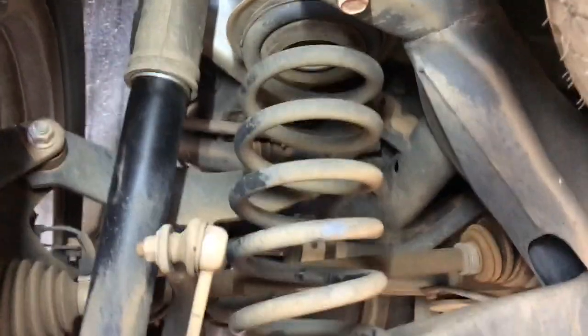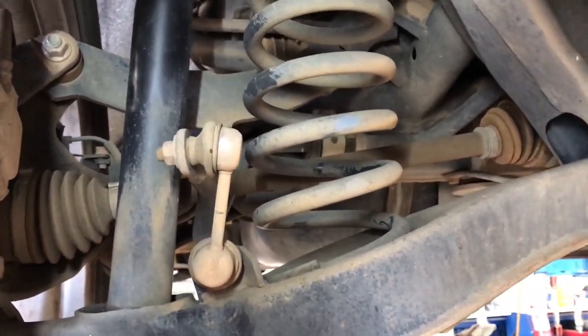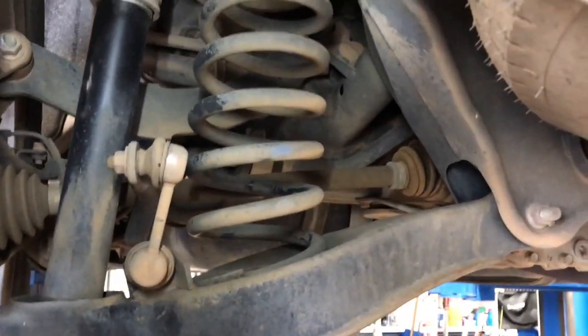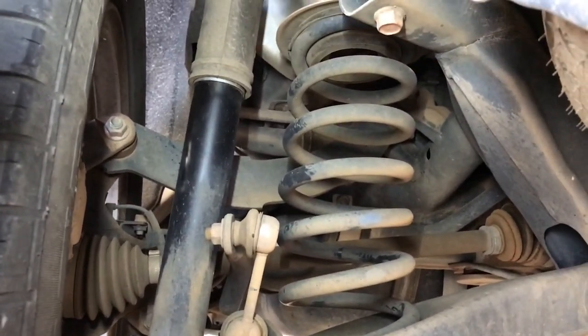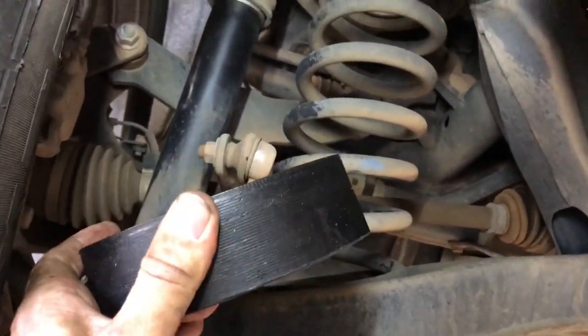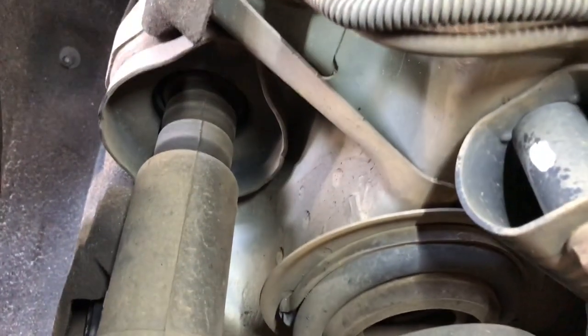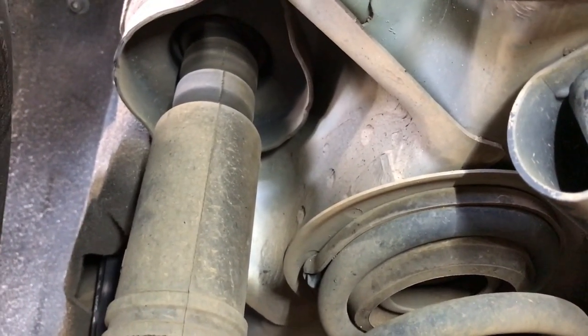Alright, so spanner in the works. I didn't even look to see what type of suspension this was. But it's independent rear with a coil spring and a telescopic shock, not a McPherson strut. Which means this spacer goes up there and lifts or lowers the shock by 40mm.